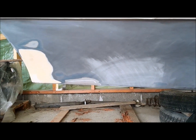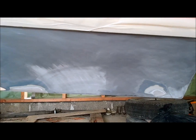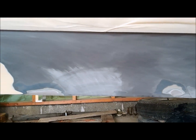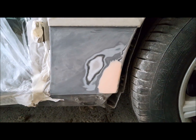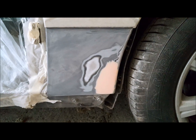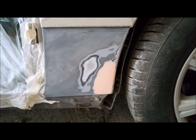All the prep work before primer has now been done and it was pretty easy. I just spread some body filler and sanded everything down flat, looked out all the sharp edges and possible imperfections and sanded them down. There was only surface rust in the passenger side front wing but I still spread some body filler on it because there were grinding marks that need to be covered up before primer paint.